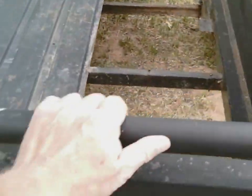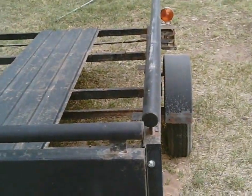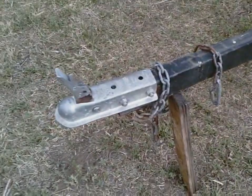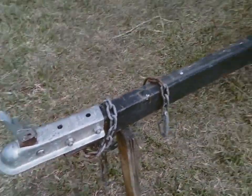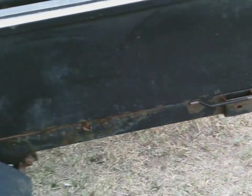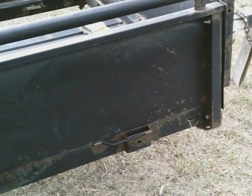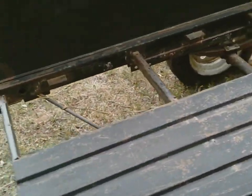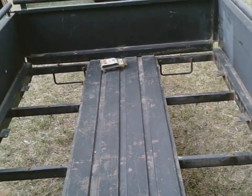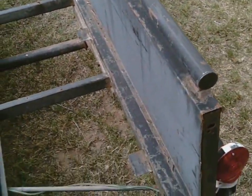With the front bolts replaced on both sides, the trailer is good, solid, and squared up so framing fits properly. Check your tongue, bolts, safety chains, and make sure the ball is the right size for the hitch. Also look for serious rust — this trailer has surface rust only, which will be sandblasted and painted eventually. Even brand new trailers should be gone over since assembly can be rushed.